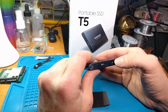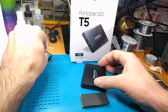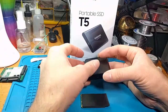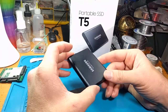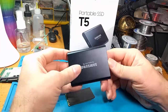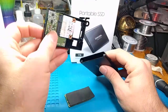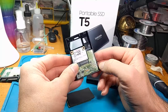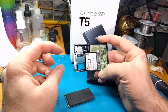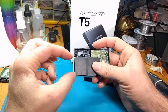There's the cover plate here and now it's basically all together. There are just two screws on each side. Originally I used my heat gun to remove the adhesive — there's just some black aesthetic tape that covers both sides. So if you're doing this in reverse to get out your M-SATA drive, you remove that tape on both sides, two screws, two screws, and you just push it out. Then you remove the one screw, undo the clips on the two sides, unclip the motherboard, and there will be two screws holding your original SSD to remove as well.